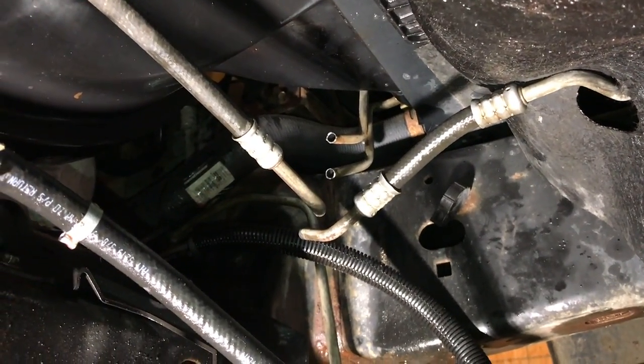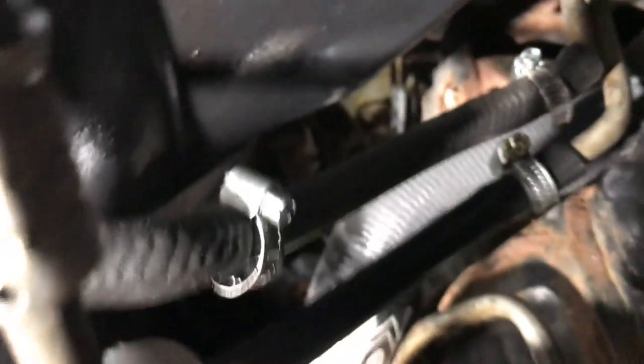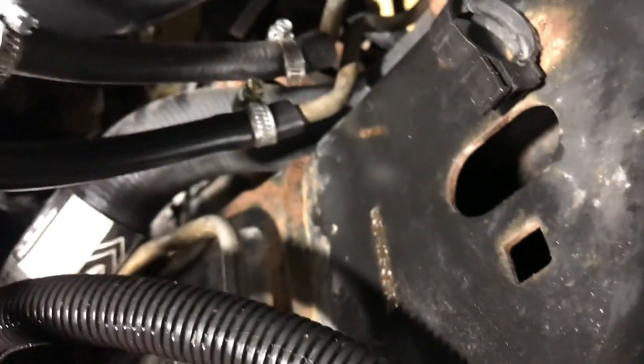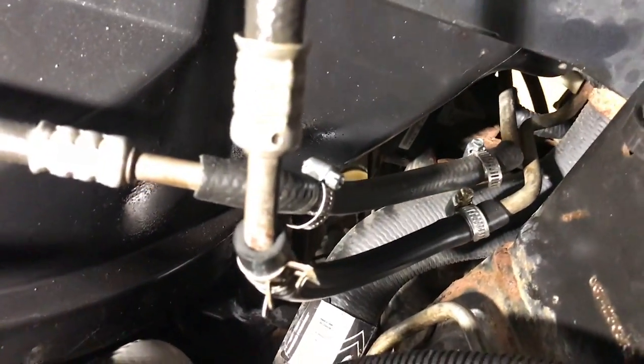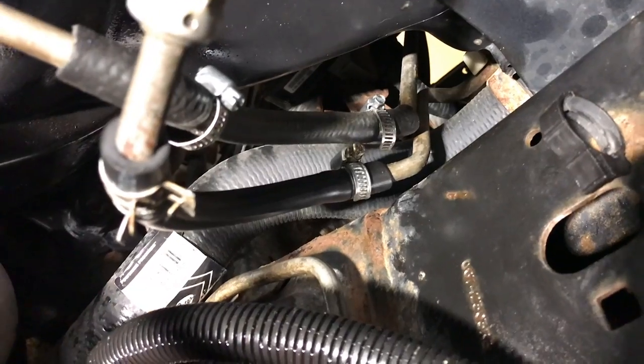I'm going to repair them with rubber hose. Here's the finished project for now — I don't like these squeeze-style clamps; they get weak over time and don't clamp down nearly as well as worm gear or screw-type clamps. So I'm going to run up to the store and grab four more of these screw-style hose clamps and double them up on each end so I know for sure they stay in place. But first I want to start this up and make sure I've got my leaks taken care of — this was so much cheaper and easier than buying whole new cooler lines just for that little rusted portion.